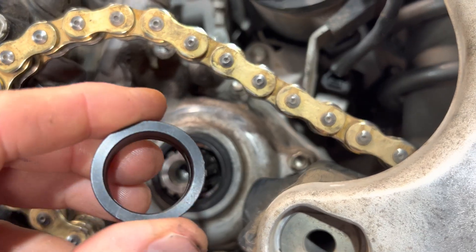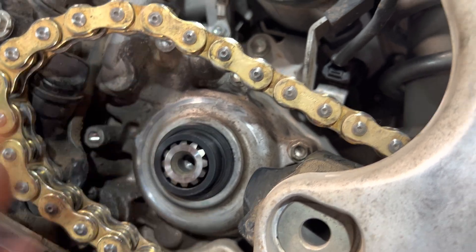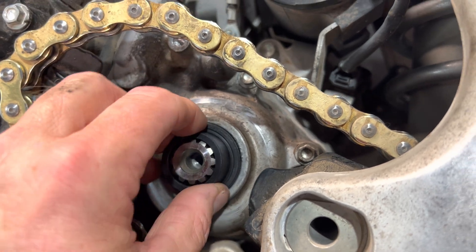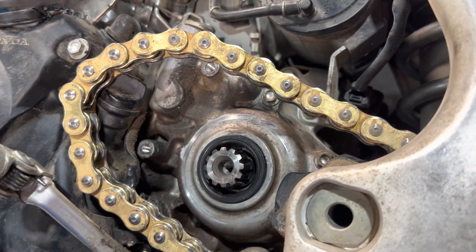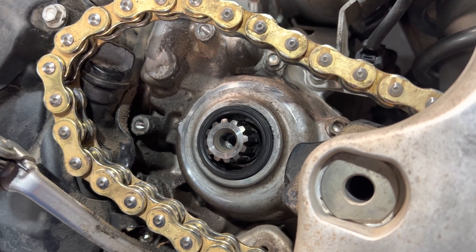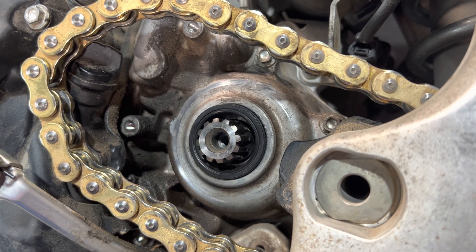Then you can come back in where you've got your grease in there, take the center race, press it in, drop it in, and you're done. Put your sprocket back on, tighten everything back up, and away you go. I hope that helps answer some of the questions you may have about replacing that seal. Let us know in the comments if you've got a cleaner, more sophisticated way of doing it. We'd love to hear from you. Like and subscribe, and go out and get some adventure.